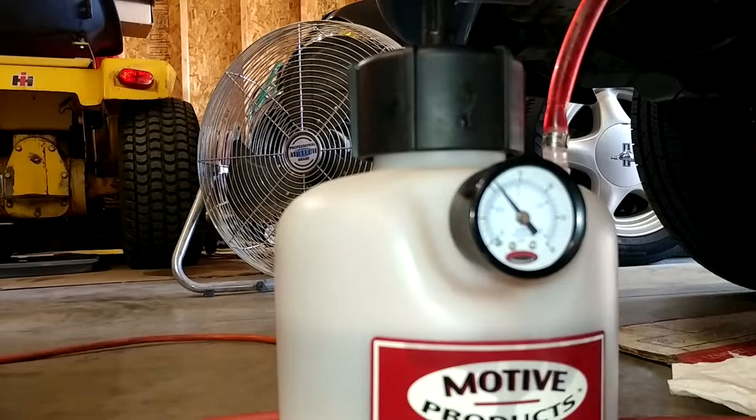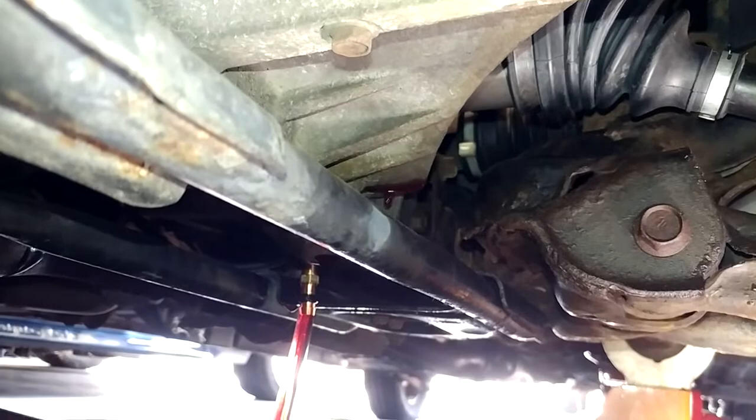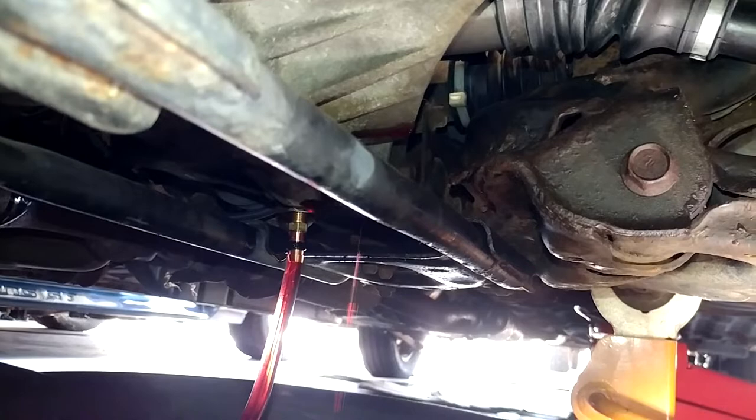So right around 2 3/4 quarts, it just started pouring out of the axle seal hole on the driver's side. Now, full disclosure, I've got the spindle and hub off of that right now. It's down at the shop getting a bearing pressed in it. So I'm hoping this is just a little loose, not seated all the way on the seal.